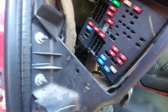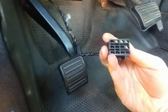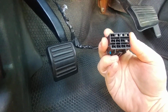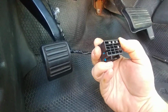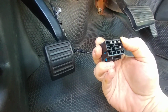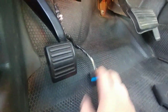If you guys want to know how to go through and troubleshoot some of these electricals, I was just using a multimeter, pinning things out, looking for state of change on the switch itself. The speakers are usually marked, they need to be an ohm or 2 or 4 or whatever it happens to be, and you use the multimeter, and okay, that checks to make sure the speaker is at least electrically good. There could be a mechanical problem with it.